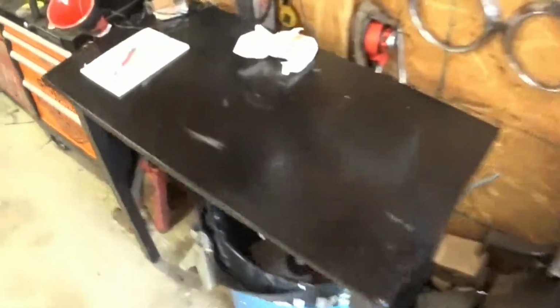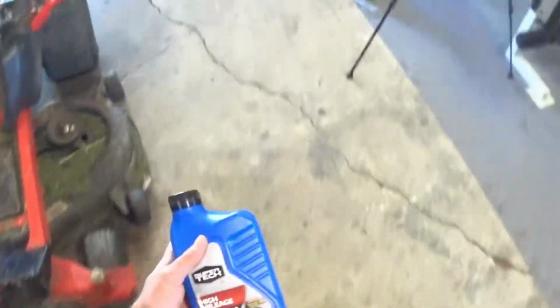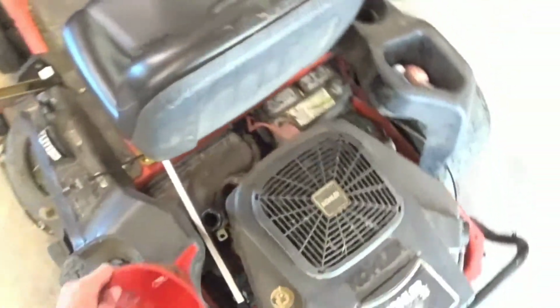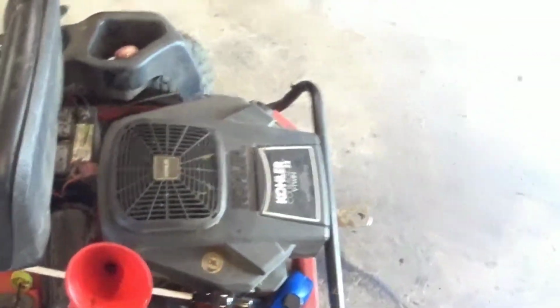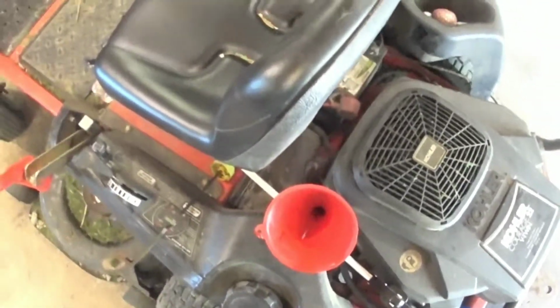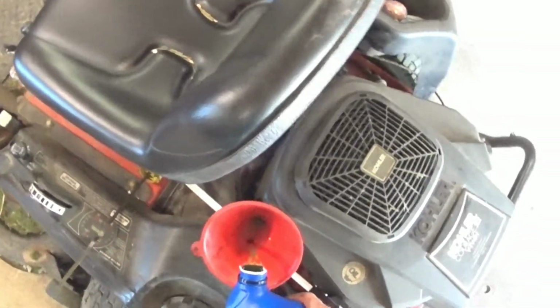So now this takes 2 US quarts, 10W30, SAE30, whatever you want to put in it. I'm putting the high mileage Supertech Walmart oil in it. It's a 10-year-old lawnmower. It runs for 30 minutes at a time. If you change it regularly, you'll never have a problem with it. If you can only change it once every 10 years, you might want to buy better oil.